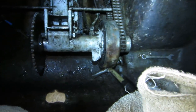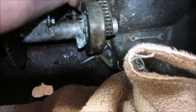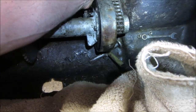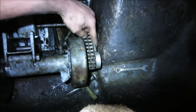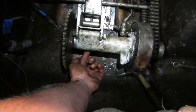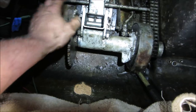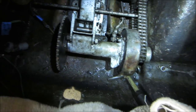We got that guy in there. That's the brake lever going to the pedal. It's got a con rod on this side to adjust the tension of the chain, which it'll probably go a hair tighter on. You rotate this guy and then you drop a pin down in there and that locks it from unrotating itself again. And then underneath right there, there's another adjustment. I came through this side with a screwdriver and that works this side of it. And then of course it went up to the engine brake lever and that was the shift lever.